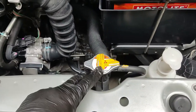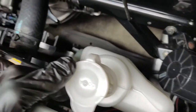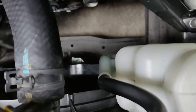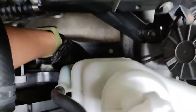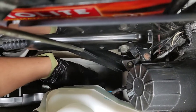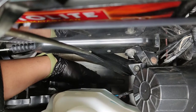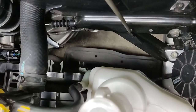The first step is to drain the old coolant from the cooling system. We need to open the radiator cap and the coolant reservoir to release pressure. Make sure the engine is cold first to avoid injury, because the coolant is above boiling point when the engine is hot. We also need to open or remove the drain plug at the bottom — I'll show you what it looks like. You just turn it by hand and the old coolant will drain out.